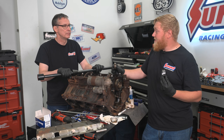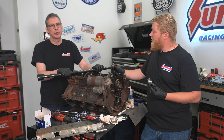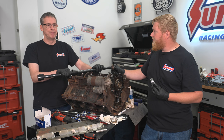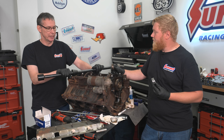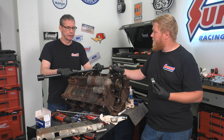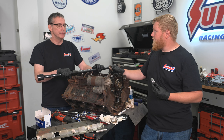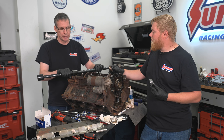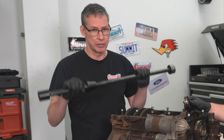They're all quite significantly larger. The factory ones are 641 wide, and they did that to save every last little bit of bearing friction and gas mileage. We don't really care about that last little bit - for what we're doing, we want this thing to live a nice long life. So we are going with the wider bearings, the third design bearings, and we're doing it with this handy dandy Summit cam bearing knocker.